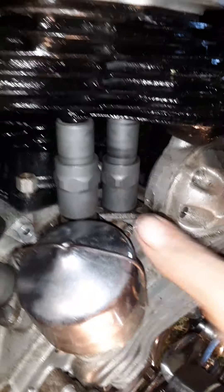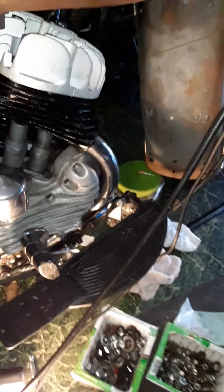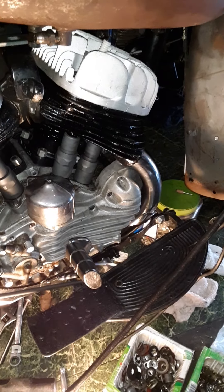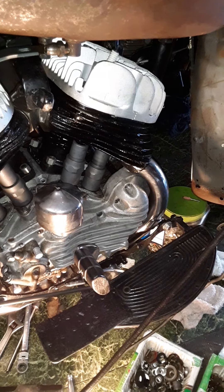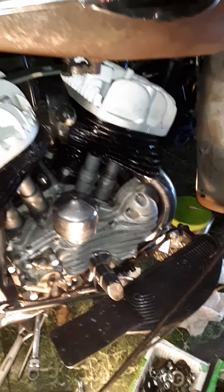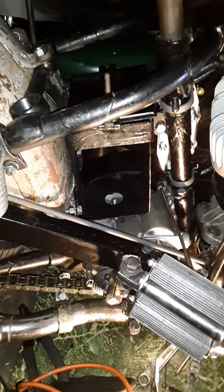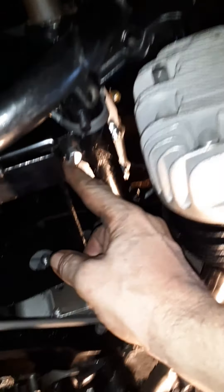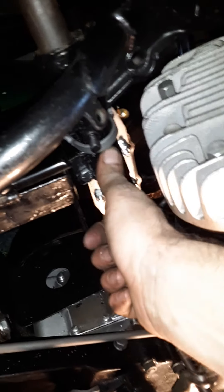It's not a brand new oil pump — I rebuilt the oil pump and the scavenger pump. All the timing gears are in there and timed. I do have two generators, 12-volt — that's one of the reasons I want 12 volts. Hopefully they work; I won't know until I put one on and test it. This is a generator model, so no alternator. Once you run it, it's running off the generator. I'm going to have a 12-volt battery that will look like a 6-volt. I got an original battery cover; it didn't mount to the fender and I fixed that.